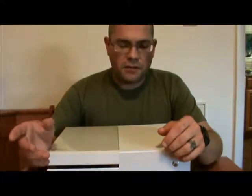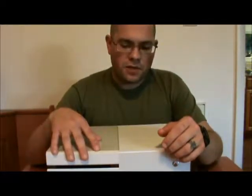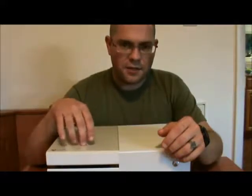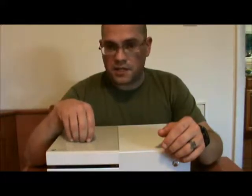The issue that he's having is he takes a disk, he pops it in, he lets the drive pull the disk in at its own pace, and he lets it try to begin to spin, but it doesn't do anything, it won't read the disk. So I checked online to see if there's any similar issues, and people were saying that it's not the laser, because I was thinking it was the point of target problem that we had with the Xbox 360. Turns out that's not it.